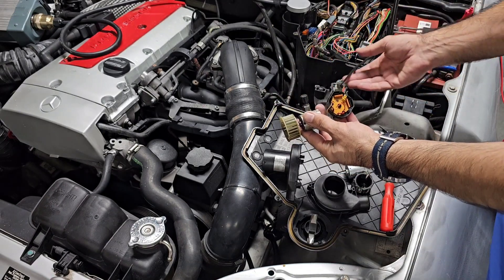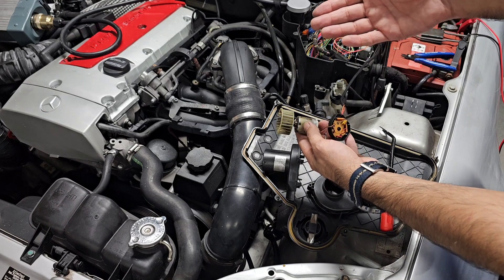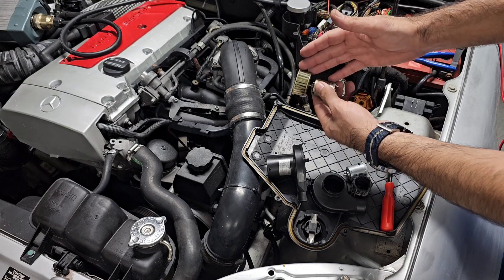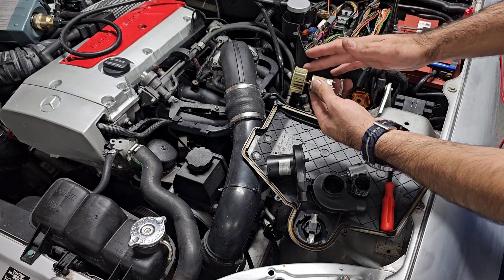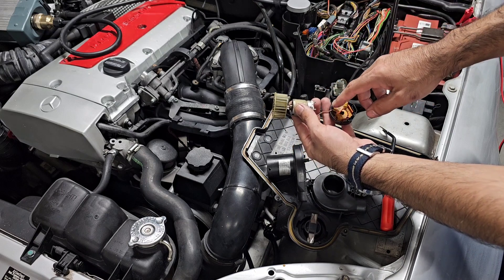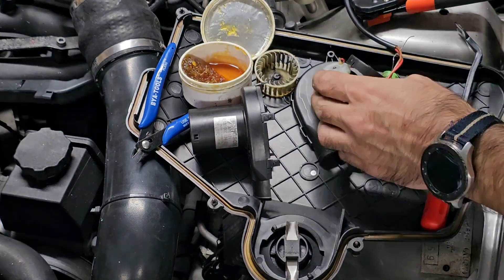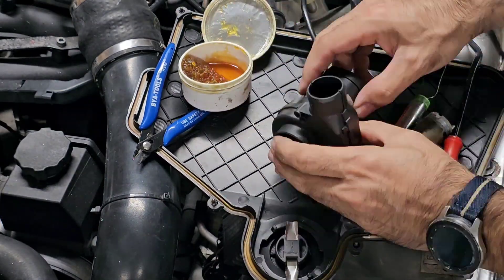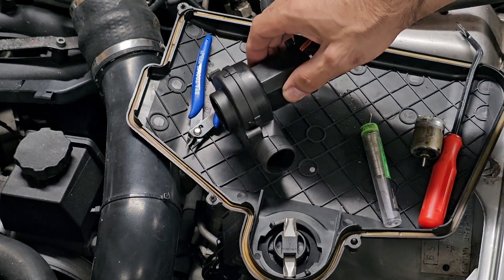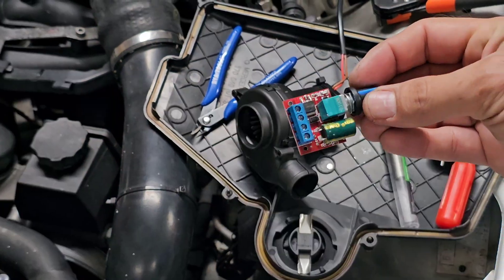It's a very good idea to install a fuse inline with this wiring because it is not fused, and if you burn out this motor you might end up with a burnt convenience module. The motor and blower fan run whenever you switch on the ignition, so it should always be running. You should be receiving 12.5 volts when the car is not running and 14 volts when the car is running.